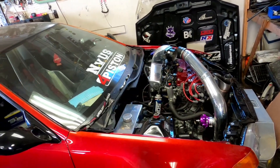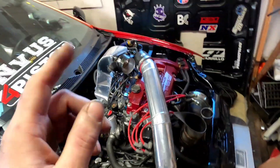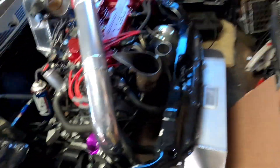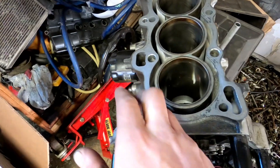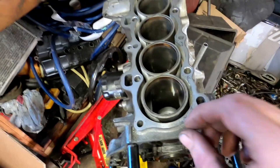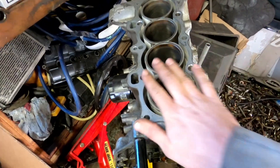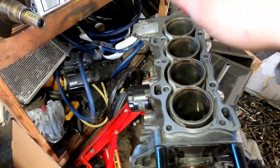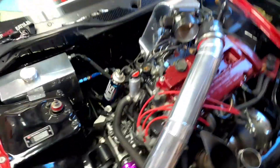I'll probably spray a little bit more in it and then do it again, and then this thing will be serviced for the winter. I'm actually pulling this all apart because I want to o-ring the block. This is just a little D series — it's an open deck motor, but I have closed deck in this. It's a closed deck dry sleeve block from Darton, and I didn't o-ring the sleeves. So what that means is you can use like .44 copper wire — you machine a groove inside here and then put the copper wire. It's a tedious task, but if you do it right, when the gasket seals and the head seals down, you have an extra layer of protection around the cylinder walls. I want to do that because I want to feed this thing probably as much boost as we can give it, right on this 67-66.